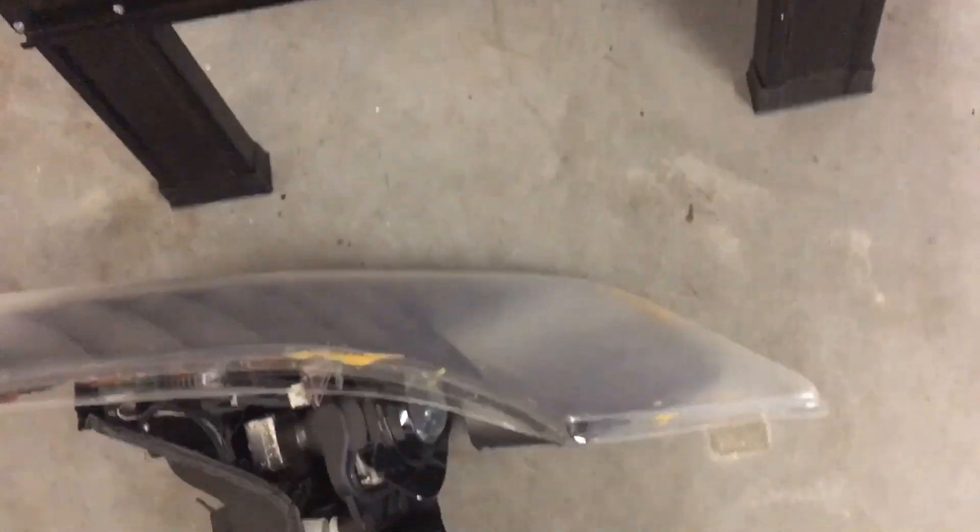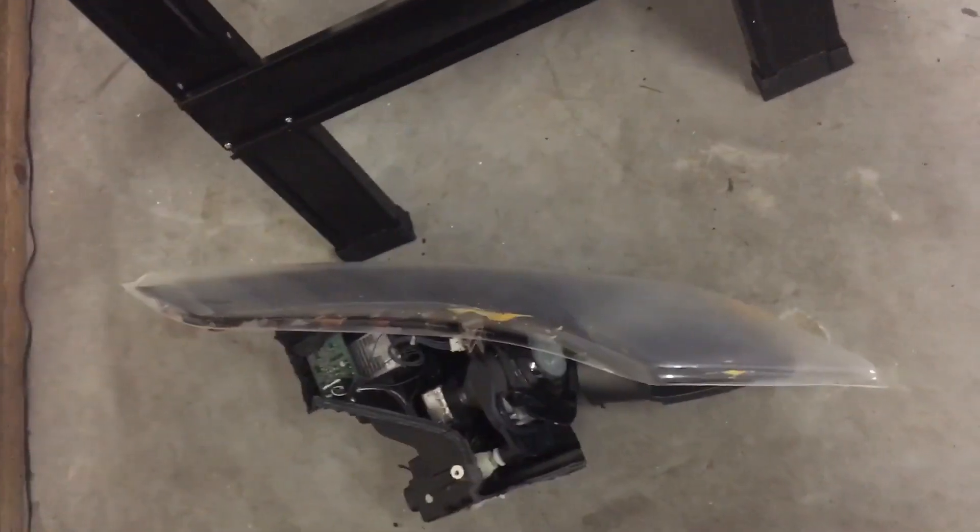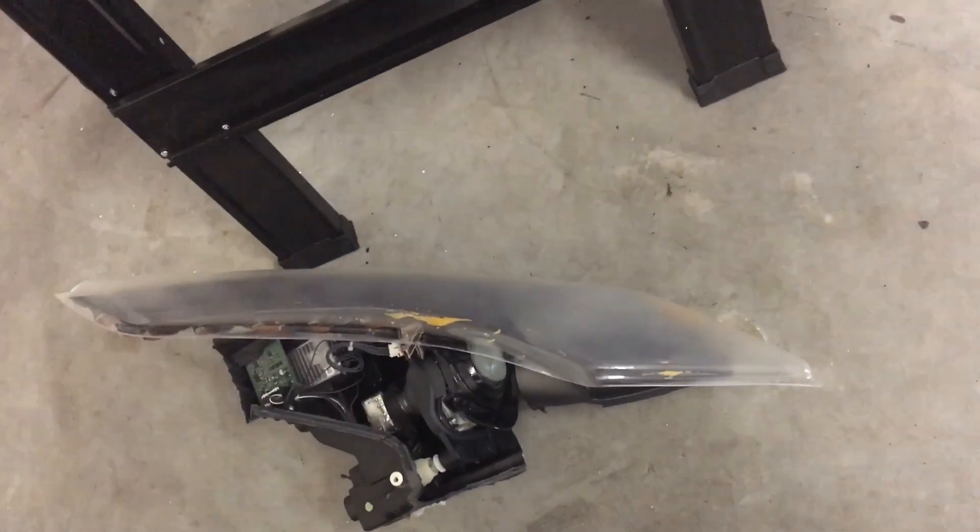As you can see here, there is one lens, and this one's got some tape on it still because I was messing with it. It's foggy because when they vacuum molded these lenses for me from the plugs I made, they're all wrinkly. So you have to wet sand them, and then after you wet sand them, you buff them out. Here's the other one sitting in here — this one's almost done and it's crystal clear. I still have to buff it a little more, but it's beautiful because it is going to sit in there just like that.